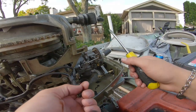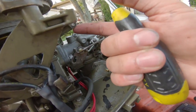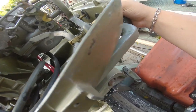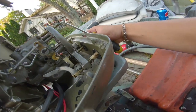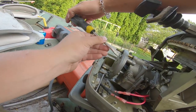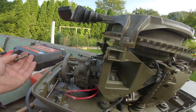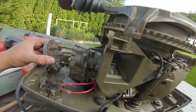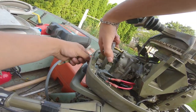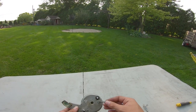The choke linkage is disconnected. Pop that linkage out — that one's good to go. This here is for low speed — this cap's going to have to come off. Last screw and then the faceplate should disconnect. That's out — faceplate is disconnected. I'm going to take it off. Okay, faceplate is off. I put these screws away right away so I don't forget where they go.